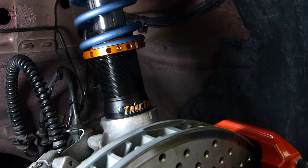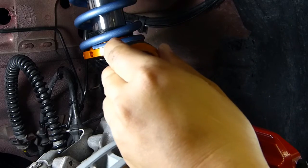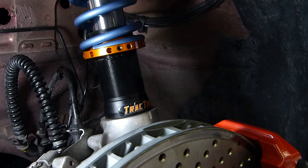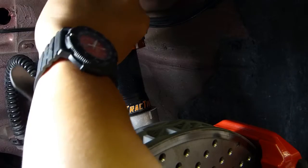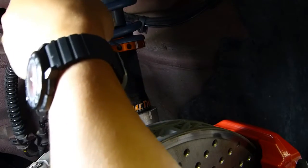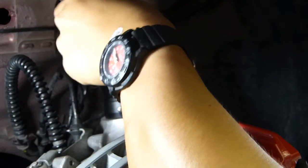From here, we'll go back to the Tractive 2.5mm bit to tighten the set screw. On the inside of the set screw there's actually a piece of rubber — a rubber tip. So as we tighten this, and we can do this a great number of times, it's not damaging the threads on the shock. Going back to the 2.5mm Allen key, I like to just keep the key around and give it a final snug. This design doesn't require much force, so you don't have to tighten it so much that you break the key off. When the key itself flexes, that's about all the torque required to hold this setup.